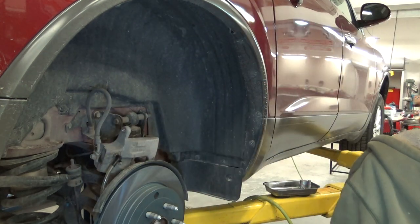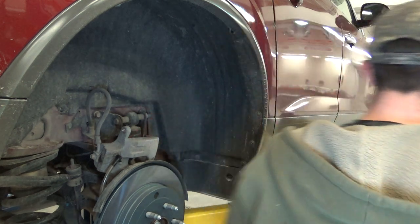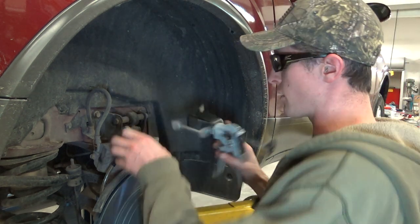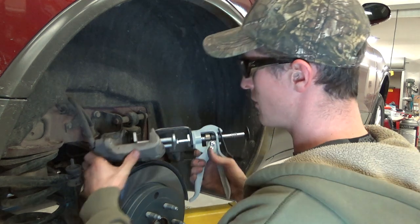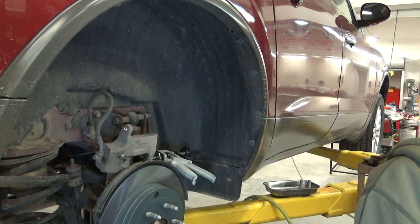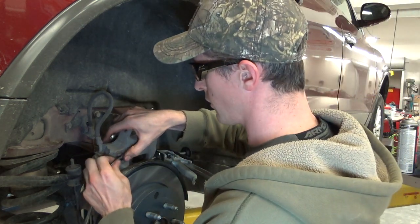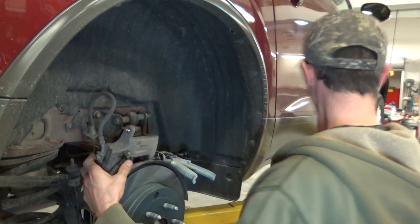Little hose on that. I'm gonna spray a boot. Might save us a couple minutes from last time. We're gonna use the double donger on the single donger piston, so we'll go off to the side with it a little bit, no big deal. Kind of trying to make sure you guys can see this. There we are. Open the bleeder, like so.